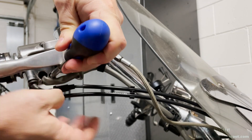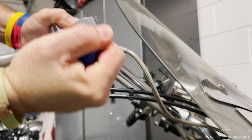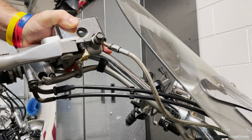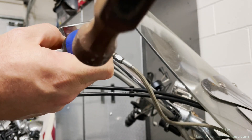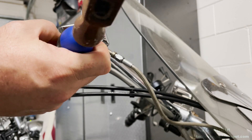A re-attempt is tried on that screw, but it's really on there. I feel like if I keep trying to turn I'm just going to tear up the screw head, so I'll try a little bit of light percussion on the screw, hoping that will break up the seizure on the threads.